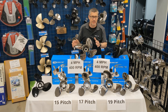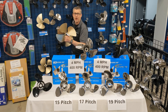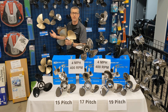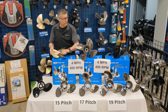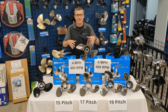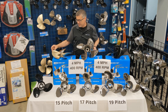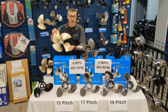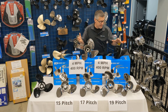You see this a lot also with even the tournament ski boats. A lot of them are running big four bladed props, brass props that are over like a thousand dollars. Why? Because a tournament ski boat weighs 3,400 pounds just on starting it, let alone adding people to it. So if you have a pontoon boat that weighs 2,200 pounds and then you're adding people to it — there's like a tournament ski boat — you need the bigger paddles to push. They don't even make this in aluminum for the tournament ski boat guys. They're right away going to brass or steel.